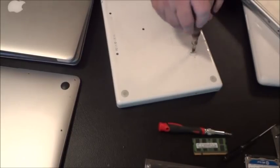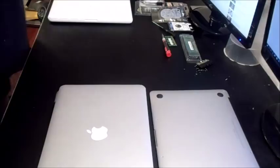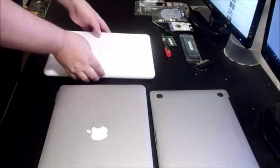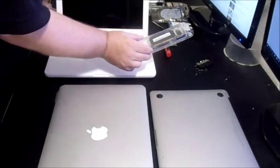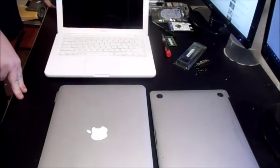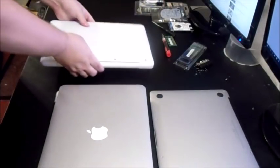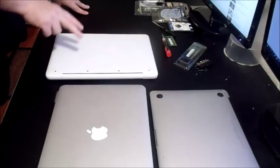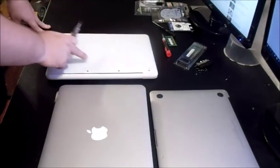You want to look for the 2009 to 2011 white MacBook — these are much nicer because they use DDR3 memory, so you can go up in speed, they have better processors, and they support higher operating systems. These will take up to OS X Mavericks. They also have rubber backs, which is another way you can tell them apart. They have a total of eight screws and the hard drive is accessible on the bottom.